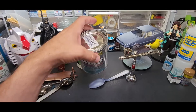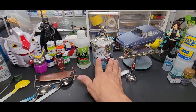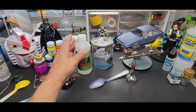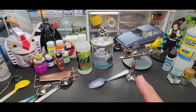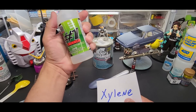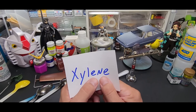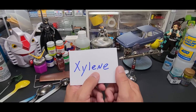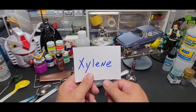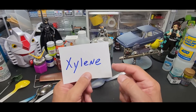It's a little thicker than the 2K that I use from my auto store, so the process took a little longer - I had to order their thinner. I looked up what thinner works with this and they replied: xylene or their own thinner. I was able to get their own from Spray Gunner, but you can also get xylene. I called three places in Rhode Island and no one had it.